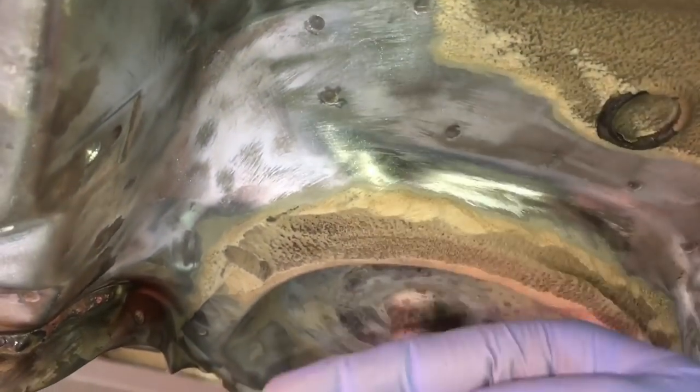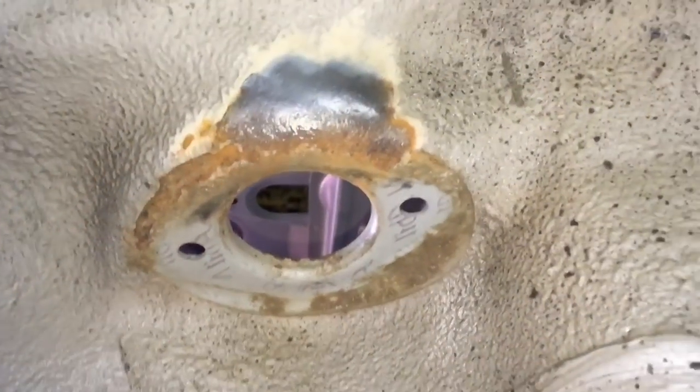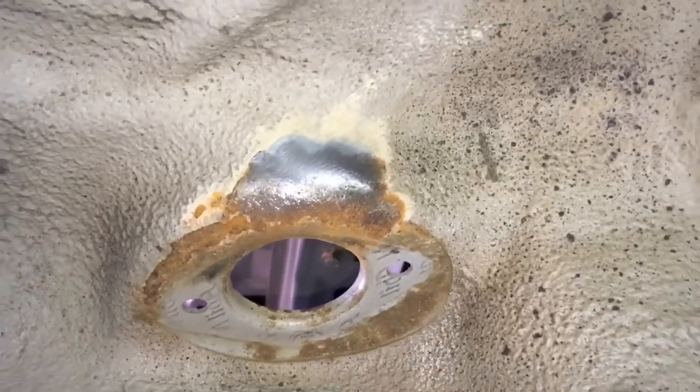Lastly, the one we talked about at the start — next to the left rear mounting point — there's where the crack was and now this spot weld here is broken. If you zoom in you can just see a crack forming around the piece above, inside the car underneath the boot floor panel. Those three are dangerous if left because that's telling us the rear axle carrier panel is coming away from the chassis down that section of spot welds — down that left hand side coming away from the chassis leg. That's why we'll be going inside and doing some stitch welding and also repair work to the inside cavities here and also the inside cavities on the front. Now I'm going to put weld-through primer on everything that's bare metal and degreased, then we'll be ready for the reinforcement plates to be welded on.